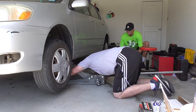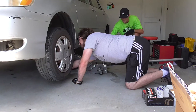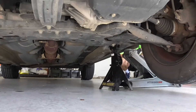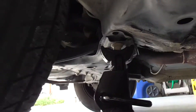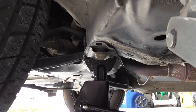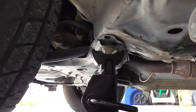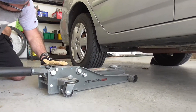The key is you never want to go under the car without proper support. What you want to do is find something solid — usually a bolt or something on the subframe — to place your jack stand. That way it's something solid and it won't fall on you.